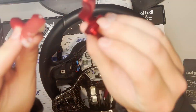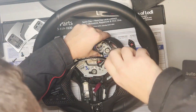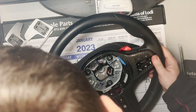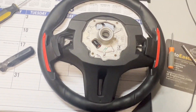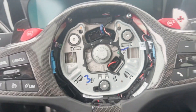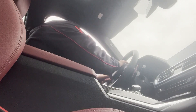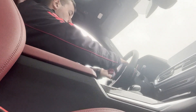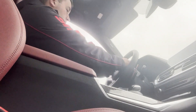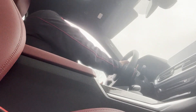Now you just have to put everything back together. Remember to put in the top piece, add whatever extra buttons you wanna add. Remember to put in your main trim piece, all the screws, all the connections that were originally taken out. Don't forget the back screws behind the paddle shifters, and once you're done with that, just screw everything in and you'll be all set. When we're back in the car, remember to put back in all your electrical connections, as well as do a good job with that 16mm bolt — it's crucial because it's the only thing holding your steering wheel in place during driving. For the airbag, don't try to jam it in or punch it. Be very gentle with it, apply a little bit of pressure, and you're gonna hear that click. It has to be aligned perfectly, and then it's gonna go straight into place.